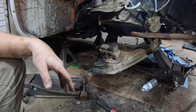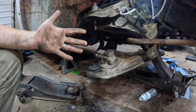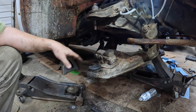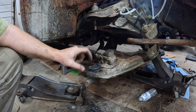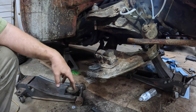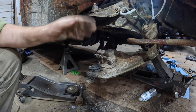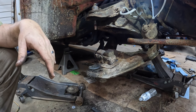That is one side disassembled - and that was a royal pain in the rear end. We've got the spring out. I went ahead and cut this ball joint off - I could have sat there and fought with it but none of the ball joint tools I have work with that thick bottom of that spindle. I know I'm going to be pressing new ball joints in here so I went ahead and cut it. We'll press this ball joint out, put a new one in, get all this stuff cleaned up, degreased, painted, then cut the spring, replace the rotor and bearings, put them on a new spindle, and put that new two-and-a-half-inch drop spindle in.